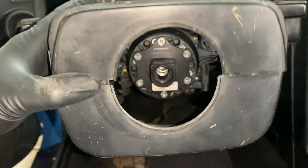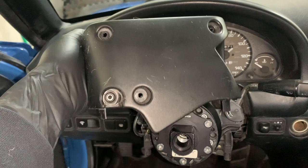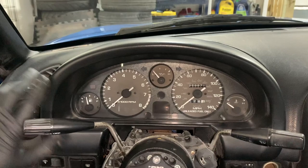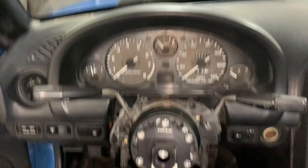The upper and lower trim pieces for the steering column have been replaced or removed. There's actually a little access door up here that's laying in the passenger seat — it's two pieces, like a clamshell. Underneath this is what you're looking for — you have four bolts or fasteners that you have to remove. Once you get those removed you can carefully pry them apart and you're now exposed. The next step is to remove the gauge cluster hood — I believe it's only two bolts, one here and one down here.